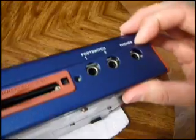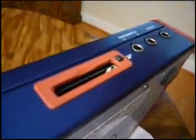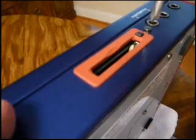damage the headphones and foot switch jacks, as well as the memory card slot here. So you have to definitely be careful by adjusting. Sometimes the jacks are a little offset. So just kind of push it over and line it up. Do the best you can to get in there without damaging your jacks. There we go, it's in place now. And now we'll just put the flat screw in the front, and then the 2 Phillips head screws in the bottom.